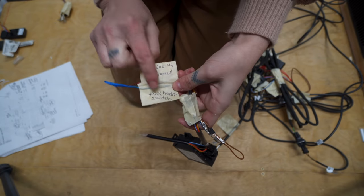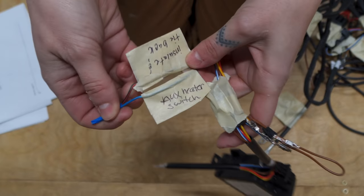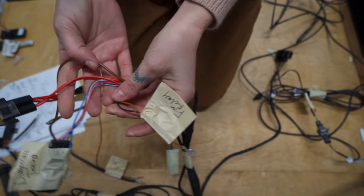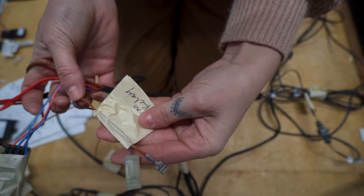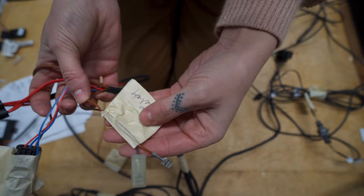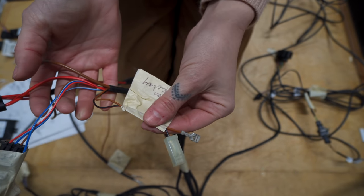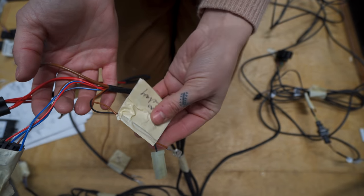The loose blue wire is used to connect to an auxiliary heater switch, which we don't have in our system, so we're just going to insulate and tie that off, in addition to a black-red wire. You'll also notice small brown and black wires with clear connectors near the battery connections. These are used to tie in a fan relay if you're wiring an air matrix directly to your heater. We decided to wire our air matrix independently, so we're also tying these off.